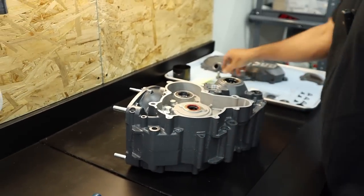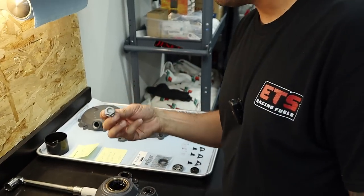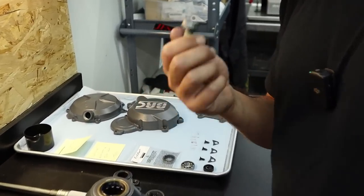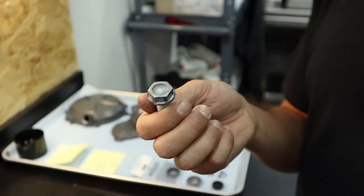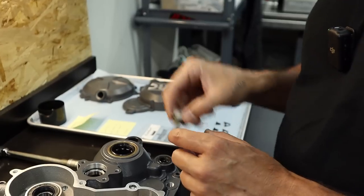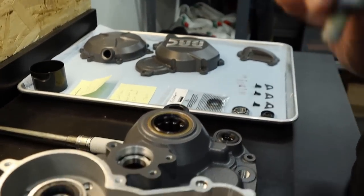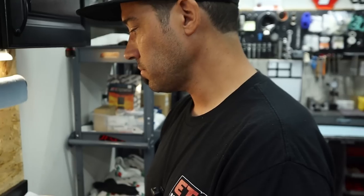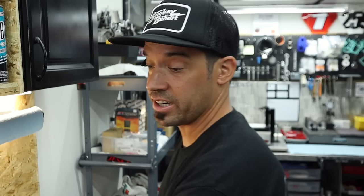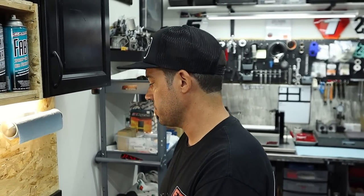Oh, we got a safety wire. We're gonna work on drilling this guy out for our countershaft, before I plate it. Before you plate it, because I don't wanna drill through that plate. You wanna tell the people what you mean by drilling that? Why would you drill a bolt? To retain it with safety wire. It's like an aircraft, helicopters. There's a high standard for retention, because you're flying in a chopper, you don't want stuff to start falling out from vibration.